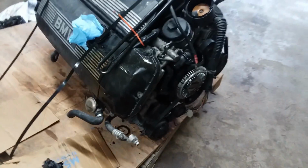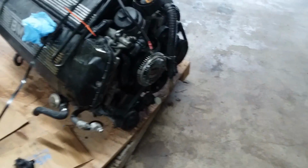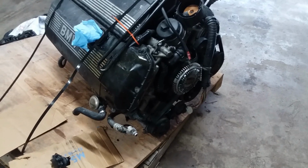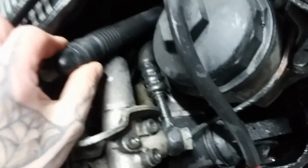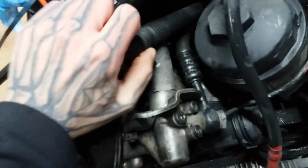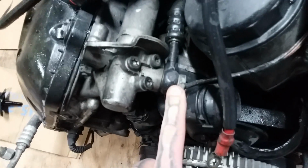Yeah, I'm pretty excited. I'm getting loopy, a little tired and funny because I haven't slept yet, like I said. I'm just glad this thing's finally here with its oily mess from the oil cap breaking. But all in all, the oil even looks, look at that. From the things I'm seeing, this is a good engine. CCV looks like it's been replaced. They're not brittle. Vanos hose would have been leaking by now, I feel. It's been replaced, maybe not.